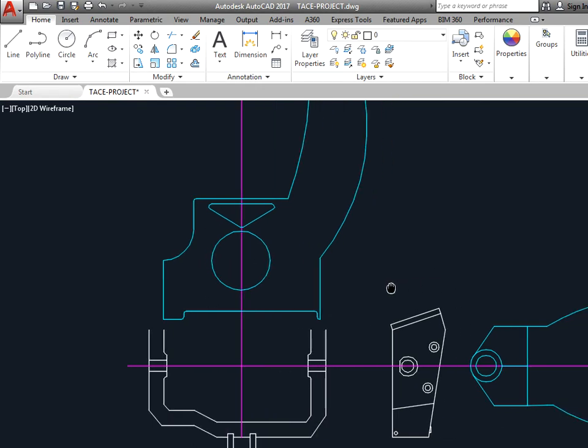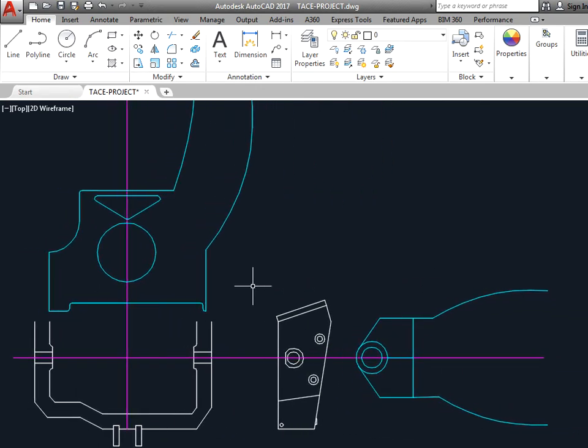Anyway, so these are the drawings. What I need to do is I think I really need to do the drawings more accurately. This was just a quick thing to get a rough idea. In fact, let me just measure this again. From the actual inside of the frame, it's 265 mil, but I do know that the swinging arm is about 280 something, I think 283. So based on that, 283 minus 265, that's 18 mil of material I'd need to move. Divide it by 4, so that's 4.5 mil of material I'd need to lose.